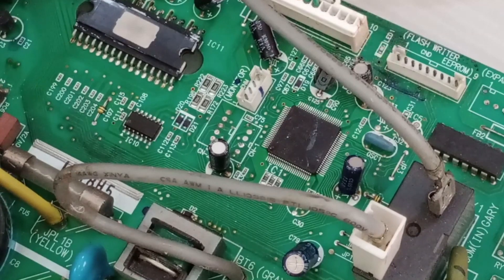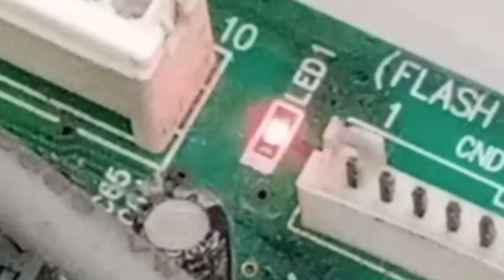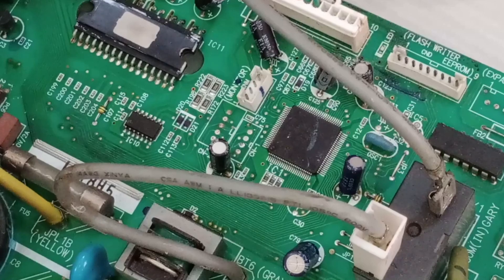Right now the LED light is still behaving normally, but suddenly the light will start behaving abnormally. Look at this — it has started blinking three times. First it blinked once, and then it began to blink three times. This indicates that the thermistors are faulty.